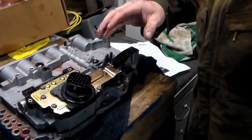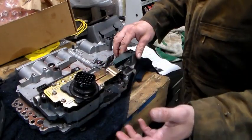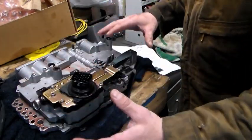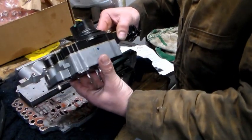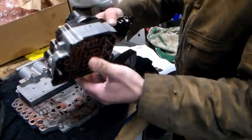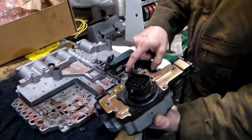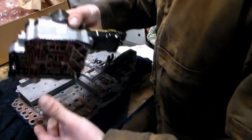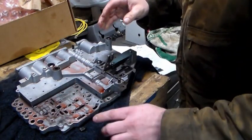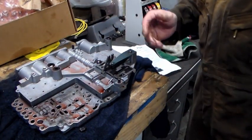I hope I helped you out here. I know the reverse lights on these Jeeps trick a lot of people — it's very tricky, and when you get reading online you can't find a definitive answer. So I took this all apart to see what I was actually looking at before ordering anything. If you have no backup lights, it's going to be your transmission range selector, which is part of your shift solenoid pack. When you order a new one, you'll be ordering one with the white connector, and if you're going from black to white, also get the new cam plate. I'm going to do a filter and fluid change, get this put back together, and I should have reverse lights then. Thanks a lot — hope that helped. See you next time.